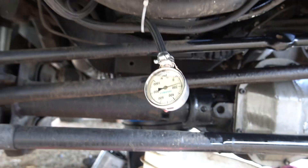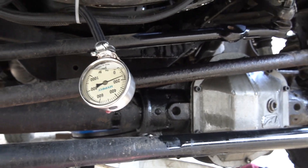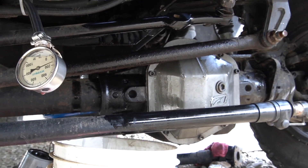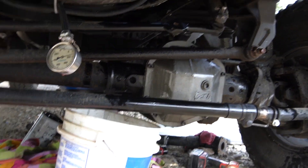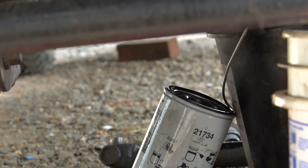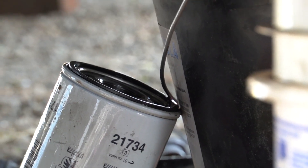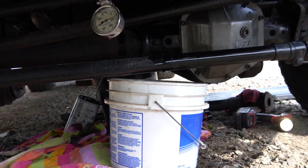The van was running great. The transmission, however, wouldn't go out of first gear. What I was doing today was checking to make sure I routed all the transmission lines correctly by hooking up this gauge — the gauge I used to test high pressure oil. As you can see we actually have pressure in there. Now if you can see here, all this oil everywhere — starting it has become a nightmare. My diagnosis is that this oil filter here, you can see the o-ring — how it's a little weird there.